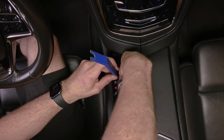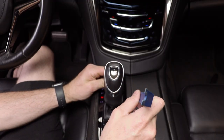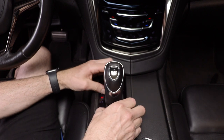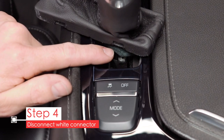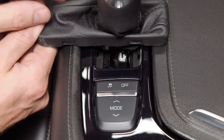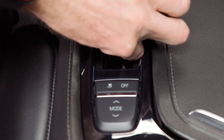Just slide the trim tool between the leather and the piano black plastic to release those areas while you pull up on the leather. Be careful not to scratch that nice plastic. Once it's free, you can lift up on the leather — it's attached to a rectangular base. Then twist it to the side so you can get access to the electrical connector below. The little white connector has a release clip on the passenger side. Reach in there with your finger and release it while pulling up on the wires. Be careful not to break the wires. If it's too hard to reach, you can use a small tool to actuate the clip, but I actually found it easier just to use my hands.